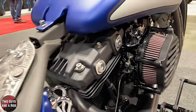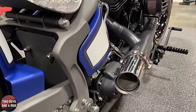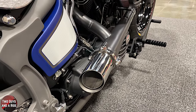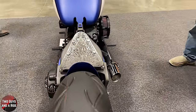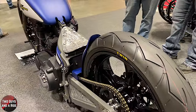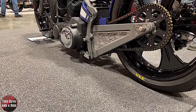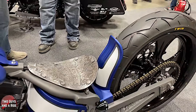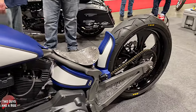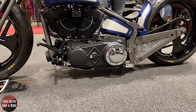I love the exhaust — how it's chopped up so you get the full swing arm. Some people may be wondering if they haven't seen a motorcycle that will lay down. This has got air in the rear. About how high up does it ride when it's fully aired up? It's about four and a half inches fully aired. And this rear fender — when it raises up, it follows with the swing arm and travels in the swing arm, so you're going to get about four more inches of protection there, or a nice backrest.